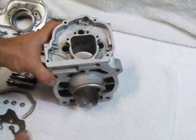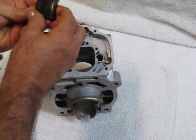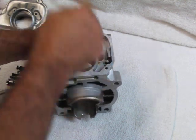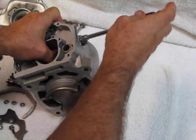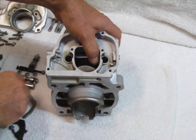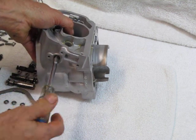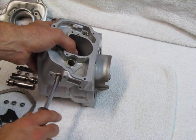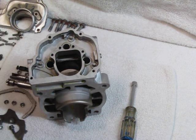Alrighty, here's our cylinder. First thing we do is we take the control flap — it's nice and clean and polished up — and we'll slide it into the cylinder like that. We take our PV axles, and all these parts are already oiled with two-stroke oil and they are ready to go. The o-ring is oiled on both sides. We run those axles in a little ways, and then strictly per the service manual.